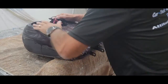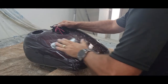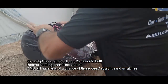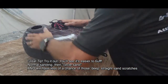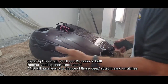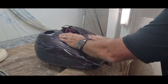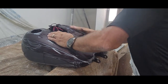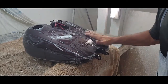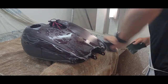When I do the fenders, especially the larger Harley fenders on the sides, I'll cut it where it's pretty much done and then do what I call circle sand — this way all your scratches go in one direction, and when you circle-sand it cuts through those scratches, making it so much easier to buff. On flat surfaces it helps a little bit, but on fenders on the side where it's concave, it really helps. If you're wet sanding and the tank's not moving, you aren't applying enough pressure — I put quite a bit. As far as the water, it's basically just straight water; I don't put any soap in it.